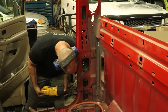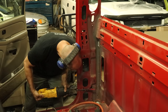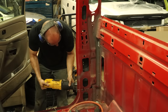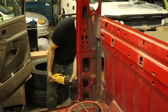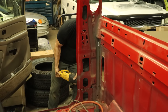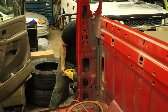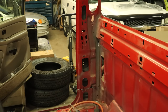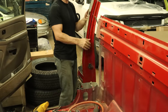Now we're going to take a Sawzall and cut through our outer panel. We're also going to cut through the inner panel, but it's higher than where we're putting it in anyway — we'll just trim the rest of that off later. Our outer panels are going to be overlapped, so the roof assembly that I cut off will be slid over this and then we can just weld to it. Gives us a nice backing, and since we don't care about how thick it is, it's not going to matter.